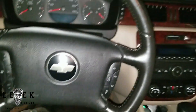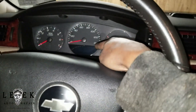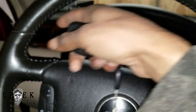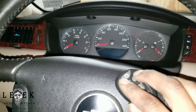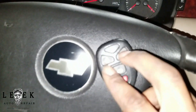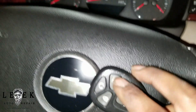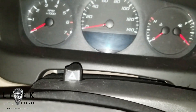How this works: some cars you can do it within the screen by pressing a couple buttons. On the Chevy Cruz or similar, just toggle through the selector on the turn signal switch until you get to the screen, then hit relearn. On this model — the Malibus, Cobalts, and some other Buicks — you want to put the key in ignition, key on engine off, then press the lock button and the unlock button both at the same time until the display shows the learning procedure is active.